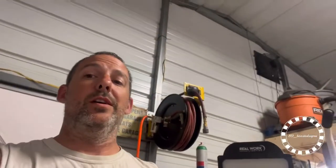What's up YouTube, we're here again in the garage. We're gonna mess with it a little — we got the top out of it, we're actually gonna put the top back in it because I gotta pull it out of the garage for a few days. Anyway, I figured out a couple things on the computer system. I know y'all seen it where I said it made like eight pounds but it was showing like 22-something pounds — what was going on with that is absolute pressure. Anything it reads on the computer you gotta subtract 14.7 from it.